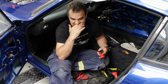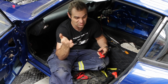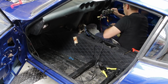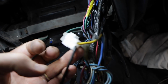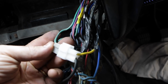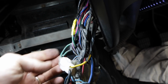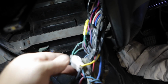The main thing that stands out to me is that something with power is directly earthed to the body where it shouldn't be. So obviously I've got my wiring all screwed up somewhere, so it's time to track that down. It's spliced into the green wires that go to where the fuel pump goes. So I think what I have here is that I grounded out one of the wires to the fuel pump, and obviously that is not what I should have done, and I've traced my issue. So it's actually come from this ground. I just grounded it up to here for the fuel pump.